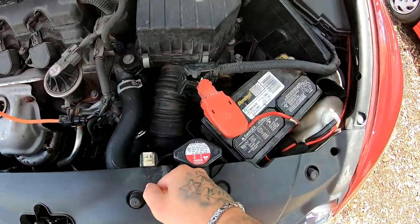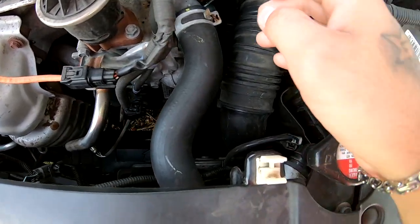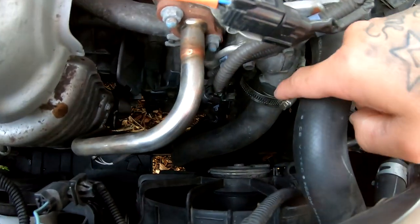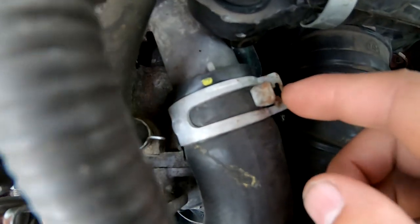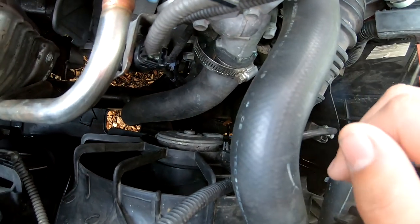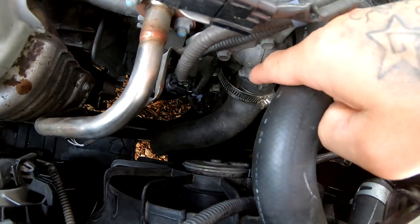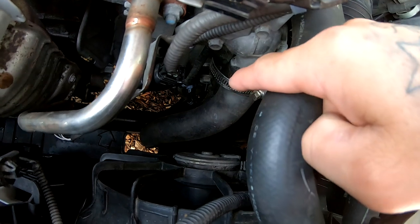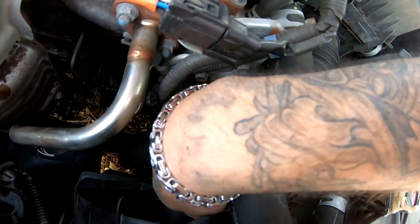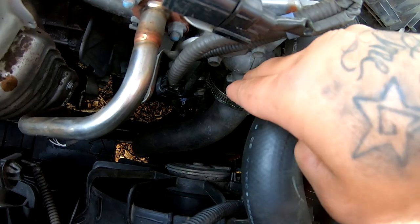So this is what I found — what the problem is. I've never had issues with this, but it seems not this hose but the bottom radiator hose. As you can see, this clamp is way different than this clamp — this is the OEM one, that one is not OEM. So basically it was starting to leak from the top. Another thing that I noticed is that this hose doesn't belong to this car. Whoever sold it to me replaced the hose with a different hose — they cut it on top and slapped it in here.